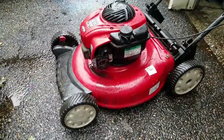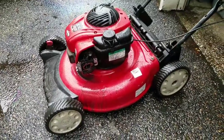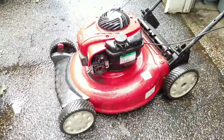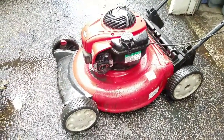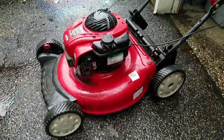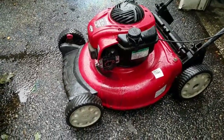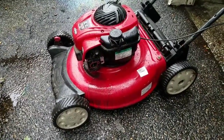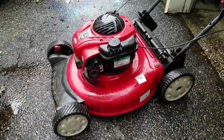It was just hydrolocked. Carburetor needed cleaning. And you gotta get that blue gas out of there. Fresh gas, clean the carb. We checked that flywheel. It was fine. And we got the oil out of the combustion chamber. That's all it was. It's gonna smoke a little bit, clean it up, put the cover back on, shine it up. It's good for maybe $125, maybe $140.